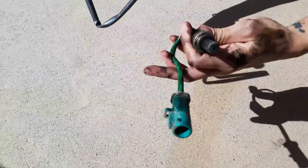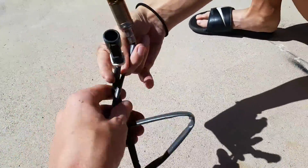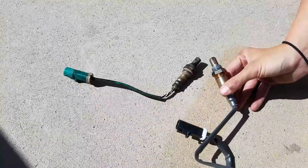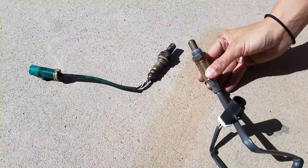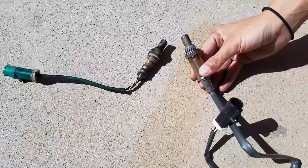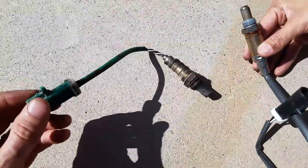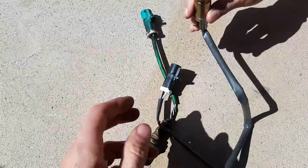We've pulled the driver's side one — you can see it there. It's a good idea to check that your new one is of similar shape and size before you try and get it off. Essentially, a sensor produces a voltage that changes when the amount of unburned oxygen in the exhaust changes. If that ratio leans too much from a ratio of 14.7 to 1, you will throw an engine light — which is probably why you're here trying to do this in the first place. Usually 9 times out of 10, it is a problem with the sensor. If you have an oil leak, it can erode a lot of the sensitive wirings and electronics. They also just fail over time.